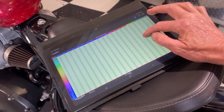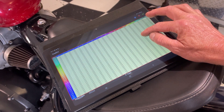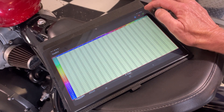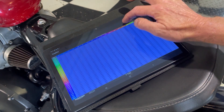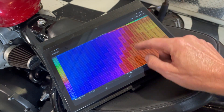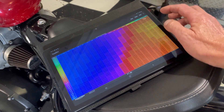I'm actually going to go 20% rather than 10%, because looking at the AFR gauge at idle I reckon that's closer to the mark. So I'll put these values in - hit Map, Apply Trims. That's gone over, so these are a good deal lower now for the duty cycling of the injectors.